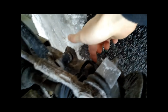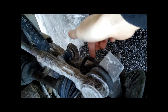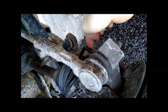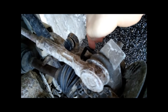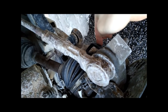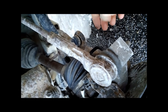Other times you'll have an issue with the other half of the harness — the part that actually goes to the car, this piece over here. Check the condition of this plastic shroud that covers the cable. If it's damaged, that could mean the wires are shorting out, which would confuse the computer. You'd have to patch it up and also find out what's causing it to wear away in the first place.